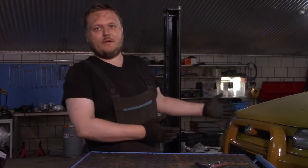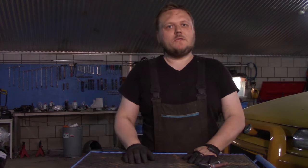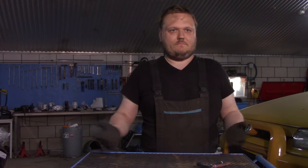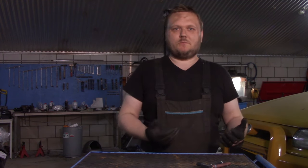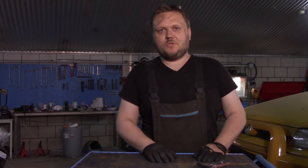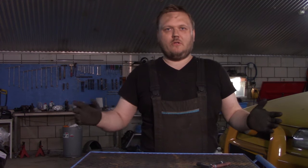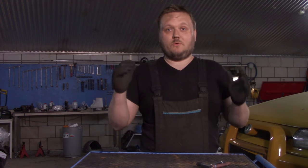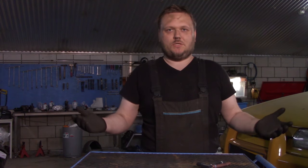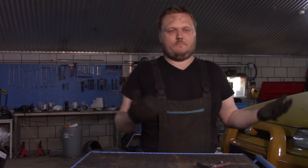I know the Skoda is right here, but something went completely wrong with the outro that I made back then. I edited the video and it was just not usable. I'm really sorry I could not get any video about how to replace those hoses. It was just not possible, and I hopefully made it as clear as I can. Be sure you have some long needle nose pliers to help you out, the longer the better. Be sure that you use some kind of cloth to protect the front of your car, because most of the time you have to lean on your engine, and most of the time you're going to scratch your paint. If it doesn't have to happen, then please don't do that.